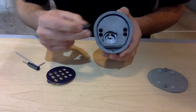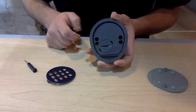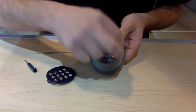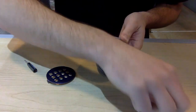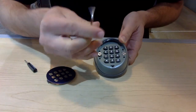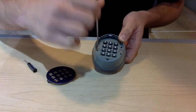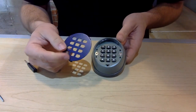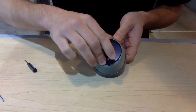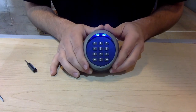Now that we've put the batteries back in, get the plastic piece that covers them and lock it into place using a tool. Then get the casing, put that back on, and tighten the screws back in — screw one, then screw two. Finally, put the blue panel back on: the end with no peg goes on first, then push it back down onto the peg and make sure it's nice and neat. And that is how to replace your batteries for your security keypad.